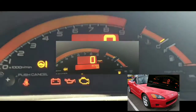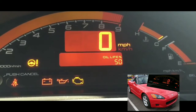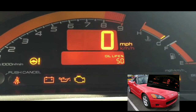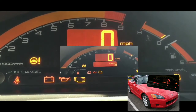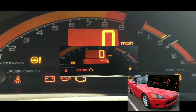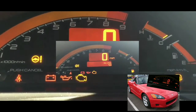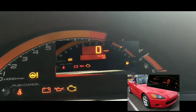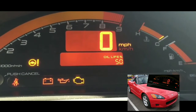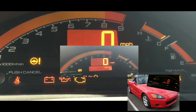Because normally when the alternator goes out, it goes out on you while you are driving, or at least have the car on, the engine running. Reason being is that the battery and starter start up the car. The alternator charges all the components on the car. So if my alternator was dead to begin with, and everything was okay, I still would be able to actually start this car up. But it's not the alternator because this car did not die while it was running.